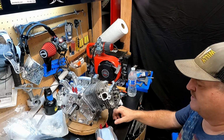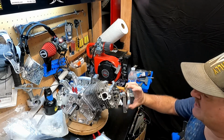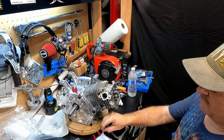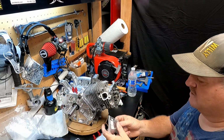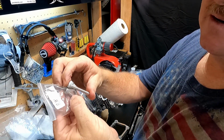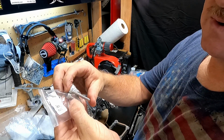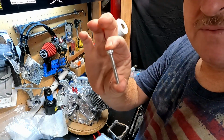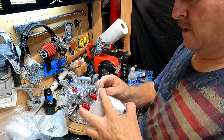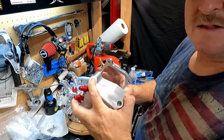I'm happy with it. It looks perfect. So we're going to put the valve cover on. Now I'm using 2 parts to my valve cover. I've got a spacer here, which I don't need. I want it basically for the fitting. So the bolts that came with this valve cover were too short. If you see, these are, I think, 25 millimeter, and I had to get some that were 45 to get it to do what I want, because I want the bolts to go through, and then to go through this piece as well. So yeah, I had to get longer bolts.